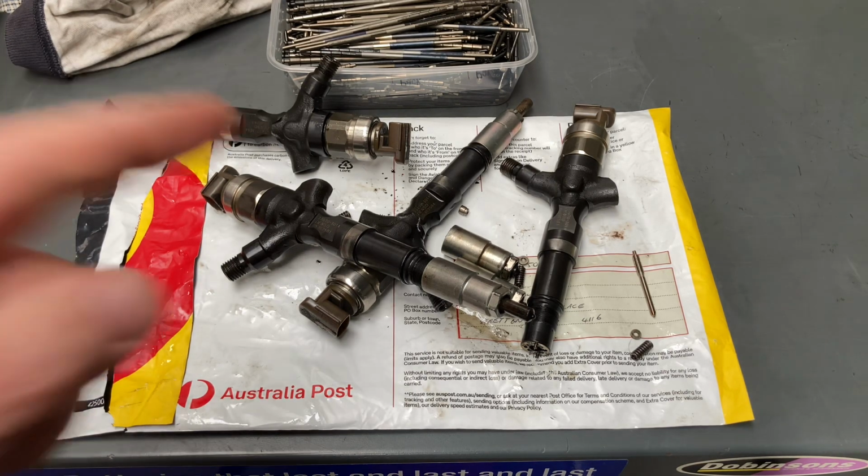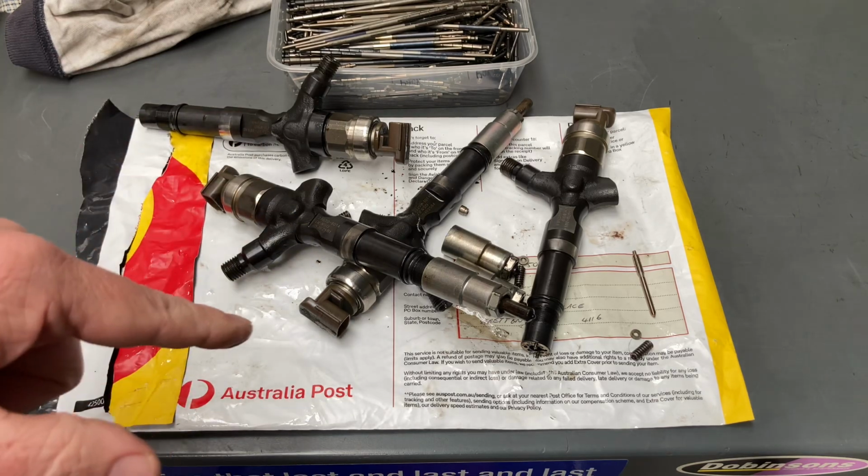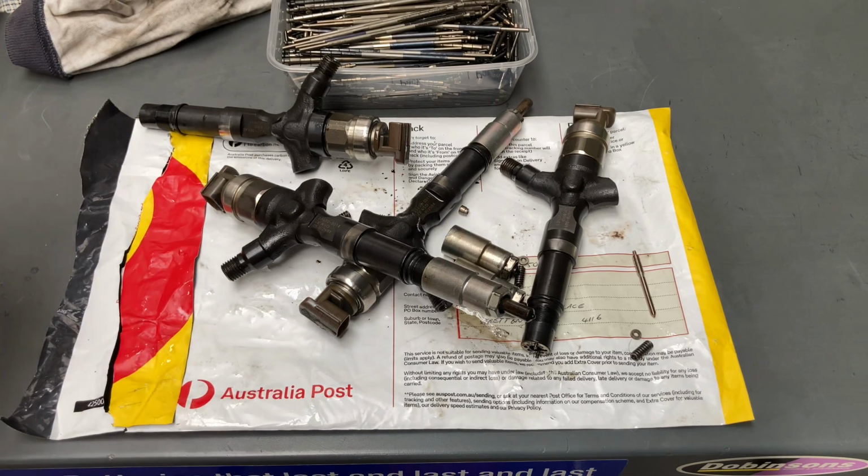Change your fuel filter. If you see contamination, then send the injectors back. And don't forget to send the lend items. If you got your injector kit from us, send those with the injectors. That's the Crow's Foot, the Dow, the Molly Coat, the Ultra Grey, and those red caps. There should be 8 of them by then.